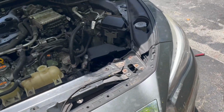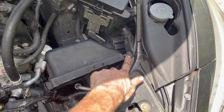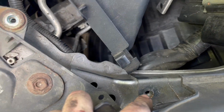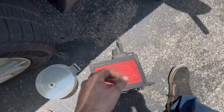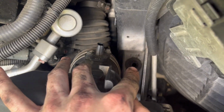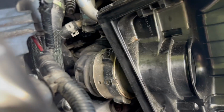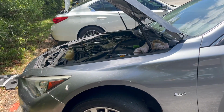So, if you don't remember from when we pulled out the intakes, there's 2 clips. There's a clip here, and on the other piece there's a clip. On the other intake thing, there's another clip, which goes here. And then there's 2 10 millimeter bolts, one there on both sides, and the intakes will go in. But just remember, the intakes have this little knob on the bottom of it, and that knob sits inside that little rubber grommet right there. So when you stick the piece of the intake in, make sure it goes into there, as well as these little clips at the bottom, which you can kind of see, also rest into these little slots. So we'll go ahead and put the intakes back in and we'll go from there.